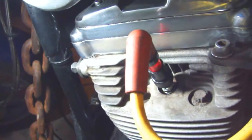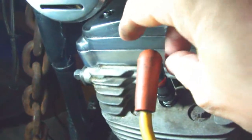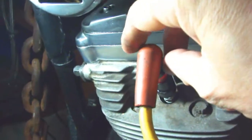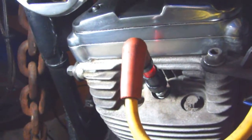And if you have a fouled plug in an emergency and you can't get any parts — say you're out in the middle of nowhere — if you can get the engine running and it's just one fouled plug, you pull the wire off and let it arc to the plug. Often that'll clean it right up.